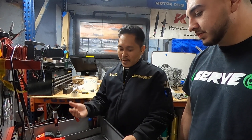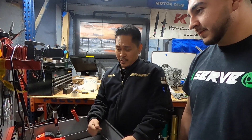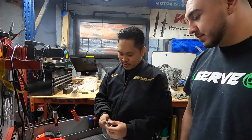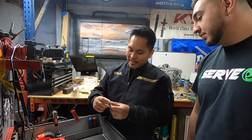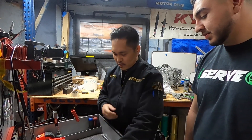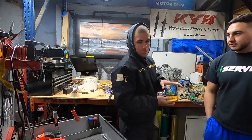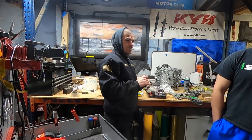I was like, oh shit, did we overstress the engine on the dyno? So we looked into it. I felt the coil packs and thought maybe the plugs are loose — that can happen. Took the coil pack out, went to loosen it, but it was tight. Finally got it out and grabbed the plug, and sure enough this thing was loose and spinning in my hand. This could be a catastrophic failure because that's porcelain right there — it can break and lodge into your combustion chamber, eat everything up.